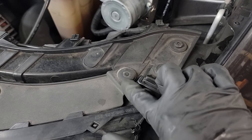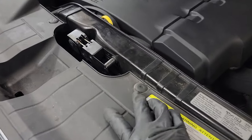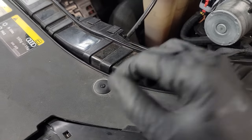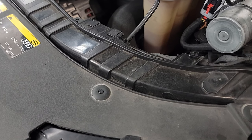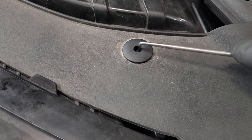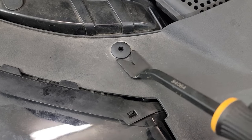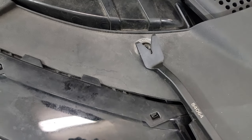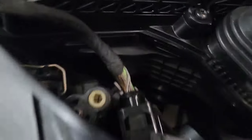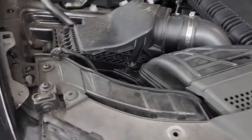One of the first steps is to remove these little push pin clips right here. Sometimes you struggle with these. There's a way I like to do them if you don't have a special tool — it's actually to push the pin all the way through. So I have just a pin here, I'm going to push it through, come underneath it with a panel puller. Careful not to scratch the plastic, especially if it's a customer's car, and then you should be able to pop those up.